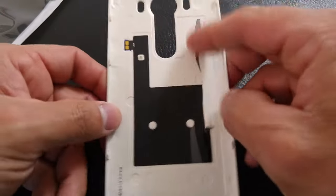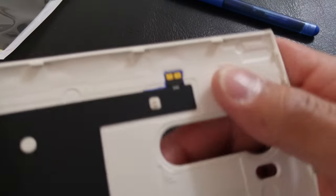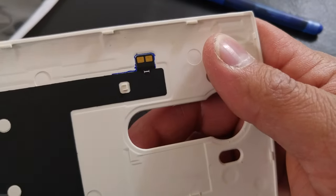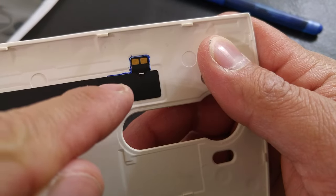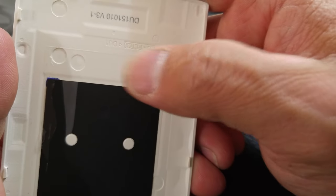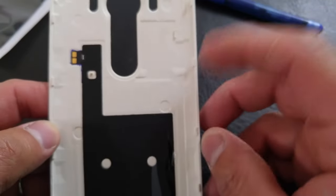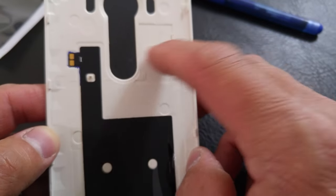We'll do an outlining of where this sits so we know where the new coil needs to sit exactly. We'll pause the video for a second to finish some cleanup. Now that our adhesive residue is off, you can see where I've made my lining around where the coil and the ribbon would sit. At the bottom, I marked where this should be level, with a little corner there and a corner over here, so we know where the bottom of our coil should be.